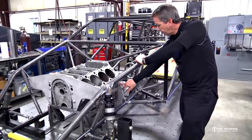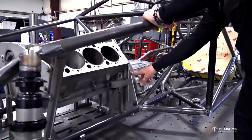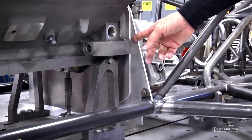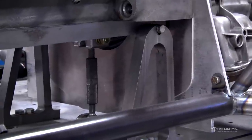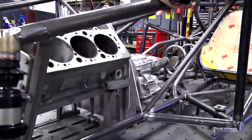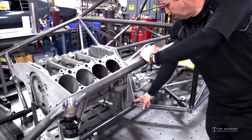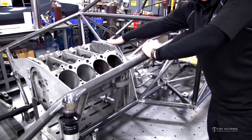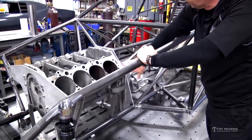We have a block protector in here. This is a single frame rail car, so it has a single frame rail mid plate — quarter inch — but also with a big hole cut out in the center. We have an eighth-inch block protector in there to keep any flywheel or converter issues from getting to the pan or the back of the block. So: block protector, mid plate, transmission. This is our upper mid plate support tube, tied into the top of the mid plate, with tabs on the main frame rail clamping the mid plate. Our firewall will come out and cover all this, fitting to the mid plate.